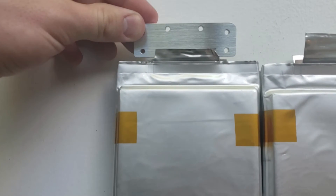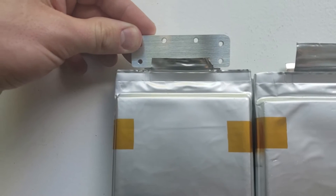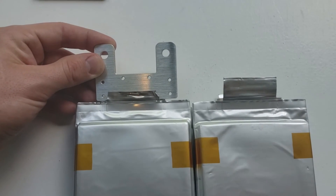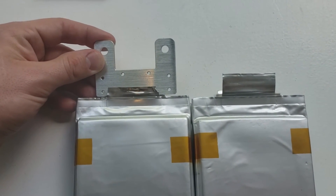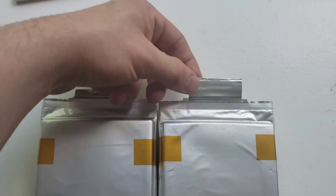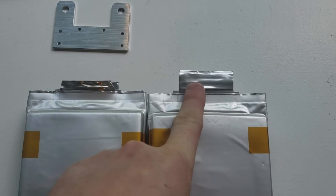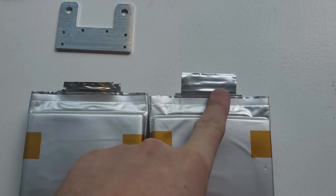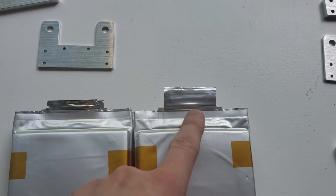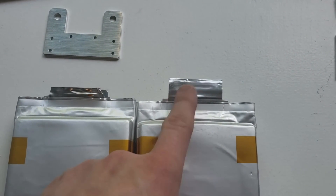Here's what I have as far as the ones that are cut out short. There wasn't much to work with because the terminals on one end were made out of copper and the other side was made out of aluminum. And clearly you cannot solder aluminum, and having just screws bolted on each terminal would give us only a small point of contact when discharging these batteries while running the motorcycle. So the most efficient way was to be able to use the entire surface that was given to us for the battery.